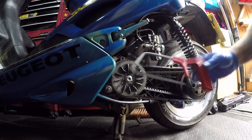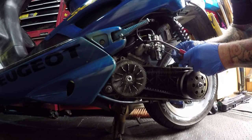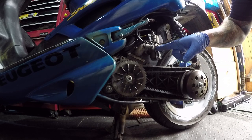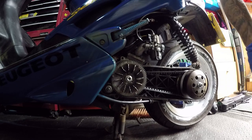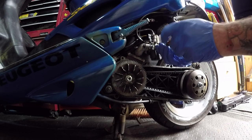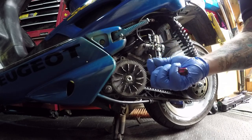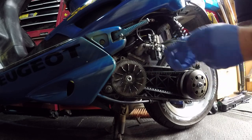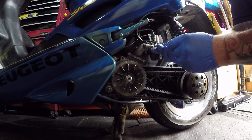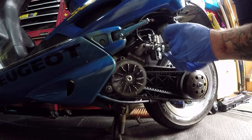Simple hacksaw. Place it here and go back and forth, back and forth like you normally would, and it will cut through this alloy really quickly and into this little screw. So easy that now I can just push that there and it comes out nicely. That is your air petrol mix. Now there's a spring in here. Let me just get hold of the spring. If I go all the way in, now I'm guessing where this was before, look how much that goes in.